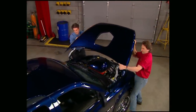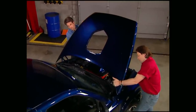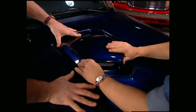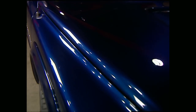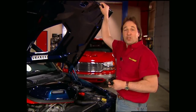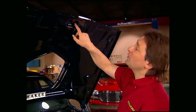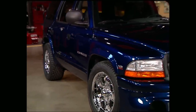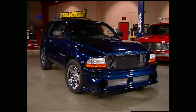Finally, we can get the hood on. You're definitely going to have to spend some time moving things around to get it centered up. Take your time on this step because nothing looks worse than a crooked scoop on a shaker hood. Once you have everything lined up, then you can put on your hood latch. We're going to reuse the stock latch, but the good news is everything is molded into the new hood, including metal inserts for the bolts. Project Durango Charger's definitely starting to get some attitude now, but before we show you what we're going to do at the grill, we need to take a break.